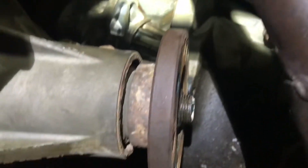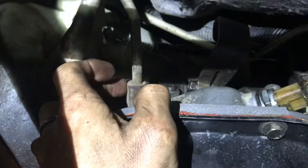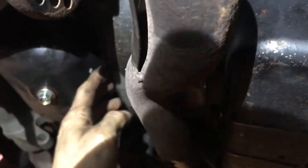We'll have to come back here in a minute for an update - man, talk about a tight squeeze. That starter bolt, the bottom one, was crazy. I had to get a big piece of square tube and get it broke loose - it was way worse than the top bell housing bolt. I got both drive shafts out. Once I take the crossmember out, I'm gonna try to get this thing to drop down and go back just far enough to get the torque converter in. If I can get the torque converter up there and drop it in, that would be sweet, otherwise I've got a long way to go.